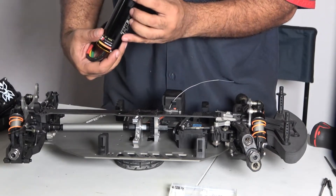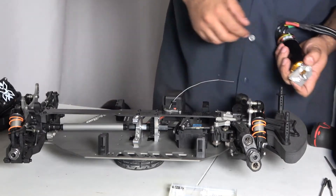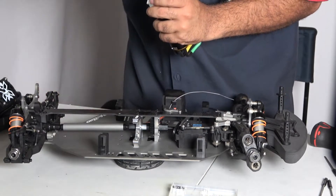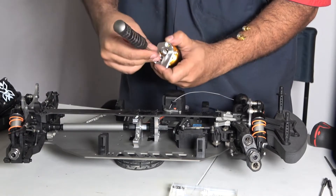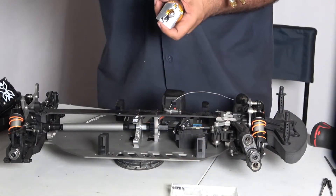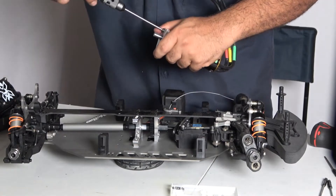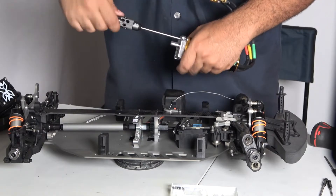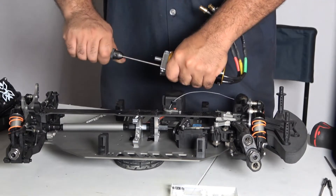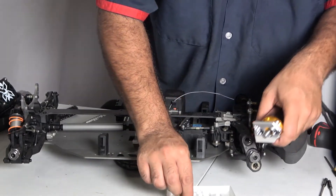Just find the position that you want. I want my motor sitting like that. They give you a lot of bolts here. First you just want to see if they fit to the spot you want. Here's the first bolt, here's the second bolt. You probably don't even need to thread lock them because there is thread lock inside the motor already. Make sure your bolts don't go through and break the winding of the motor. There you go, that feels good.